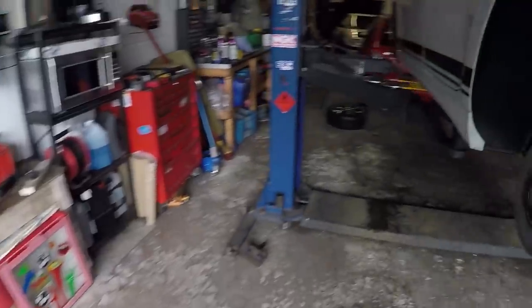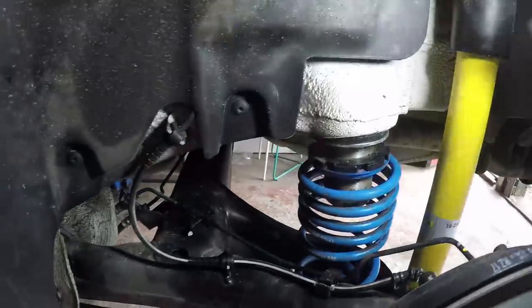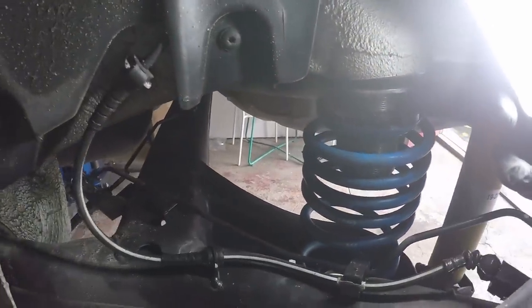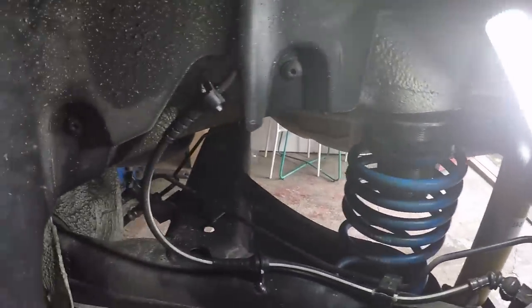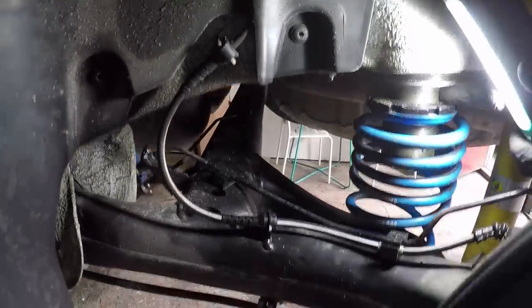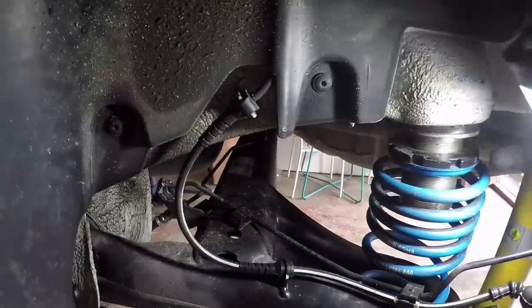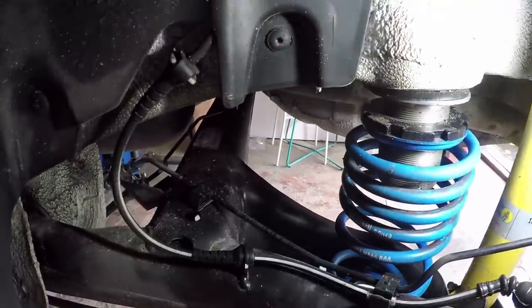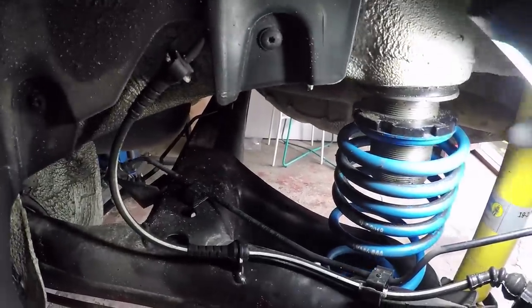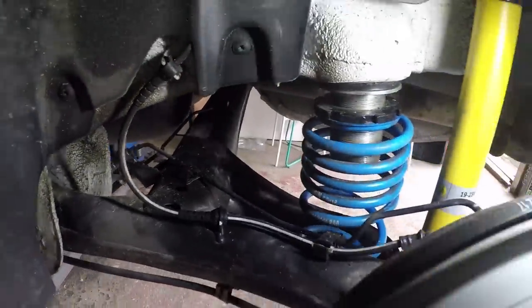Let's start at the back. Just like the normal car, we've got a separate spring and damper. The big difference is we've got the adjustable spring height platform. That's how much it is off the lower setting, probably about 12 to 15mm. But you've got all this adjustment underneath the platform to make it higher — I reckon you could get it as high as a standard UP GTI, possibly even as high as a base UP. So there's loads of adjustment there.